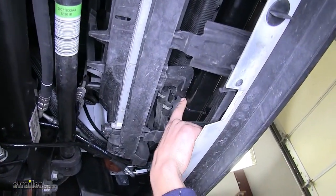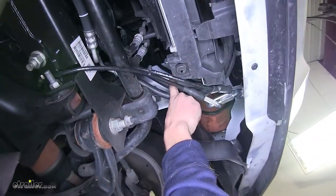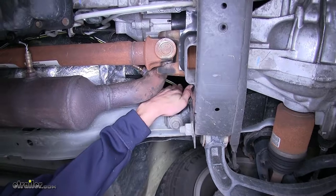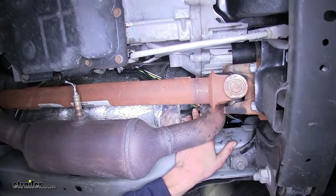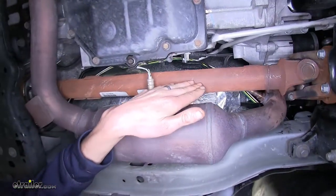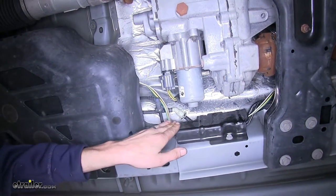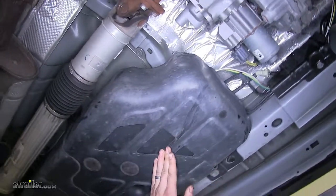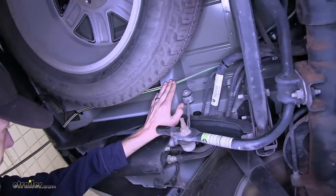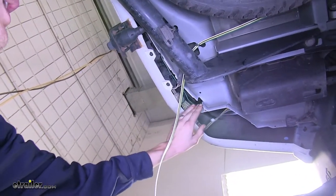Here's our wire inside the electrical tape, zip tied to the back of our base plate. It goes around the side of our radiator, up into our engine compartment to clear all of the moving components of our steering and our suspension. We have it zip tied to a transmission shift cable here to avoid our exhaust — try to keep it as far away from the exhaust as possible. Then we have it following our brake and our fuel lines, avoiding our drive shaft. It goes behind the shield for braking and fuel lines, over our fuel tank. Then we have it zip tied to a wiring harness, zip tied to our fuel filler neck, alongside our spare tire, over our hitch, and zip tied above our hitch right behind our driver's side bumper opening.